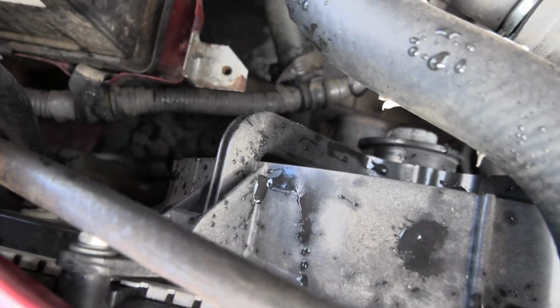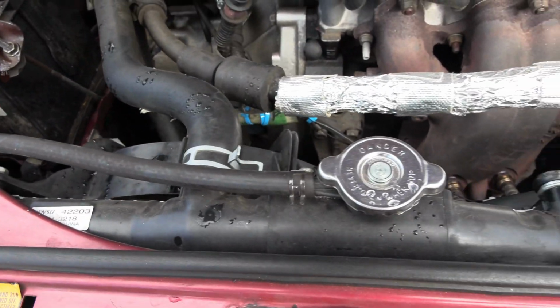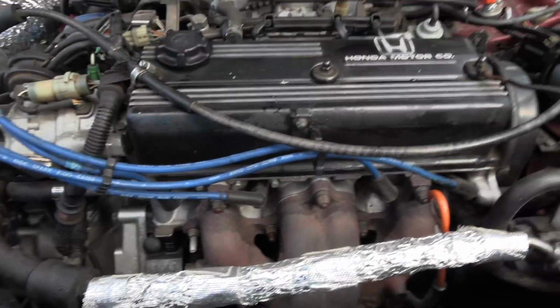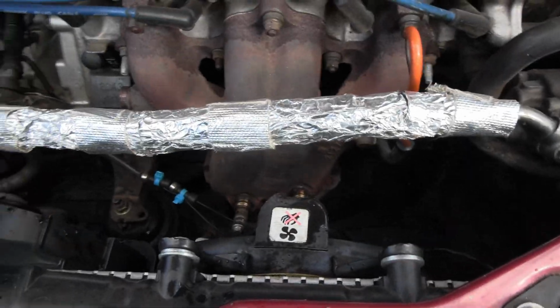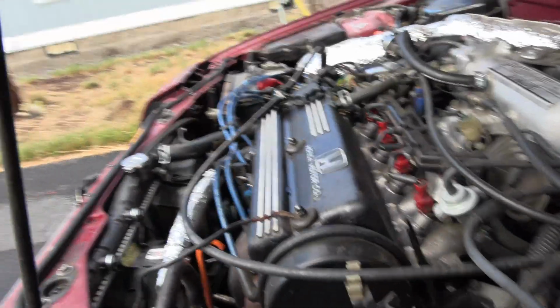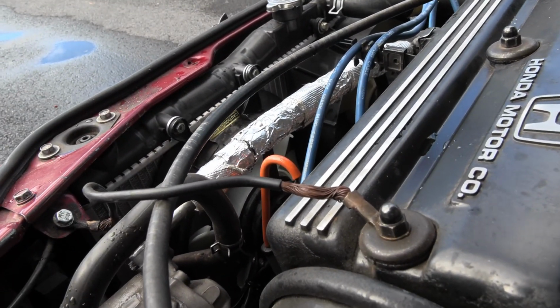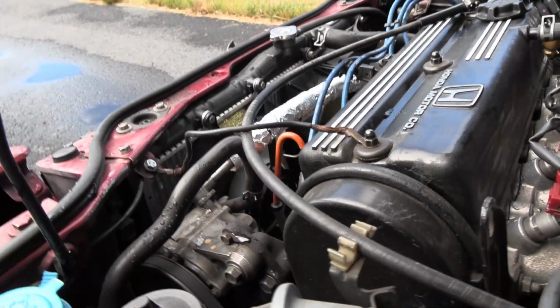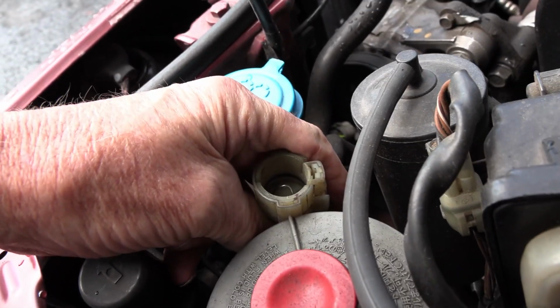Now down in the bottom of the radiator on this side, you can't see it, but down there on the bottom of the radiator is your sensor that turns the fan on when it gets warm. So now, whether this sub fan comes on when you shut the engine off on a hot day is, well, your fan timer has to work under the seat too, and those fan timers often go bad. So what I've done is my air conditioning is disconnected and gone, and so I just got a little jumper in there on the pressure switch.